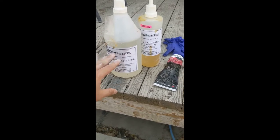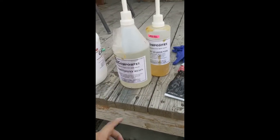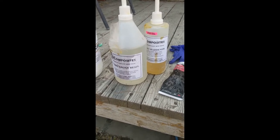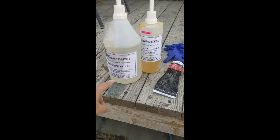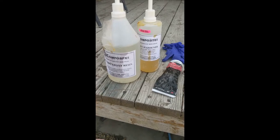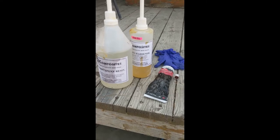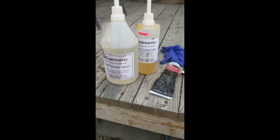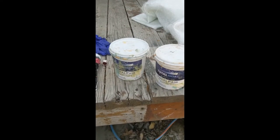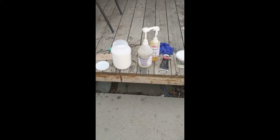This is a little bit harder than this. The only problem with using epoxy is that it's a lot harder to sand and smoothen out if you're trying to sand areas with thickened epoxy. And then the other side of it is just a normal fiberglass part of the hull. You're going to have lows and high spots because the epoxy is a lot harder to sand. So that's what's beneficial of using a fairing compound. Between all these, that's pretty much all you need.